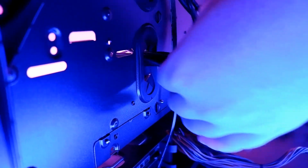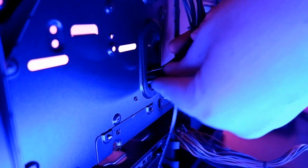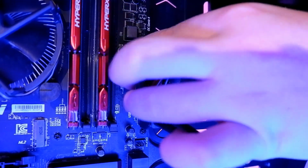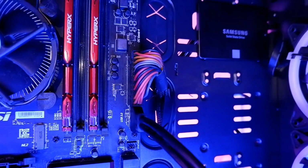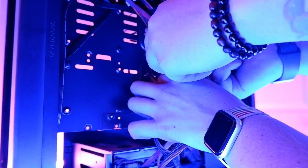I took care to hold the rubber in place while feeding the wire in, as it often came out of the slots. My graphics card got powered, the motherboard installed, I mounted the SSD onto the side of the case and wired the power button through a tiny hole at the bottom near the power supply. Everything is neat and tidy, and the case comes with cable ties to tie everything together, so even though you don't see the wires, they are still neatly packed at the back and tied together for ease of mind.